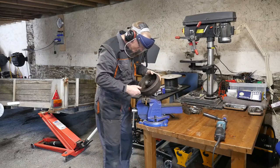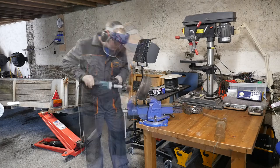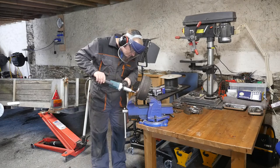Part three of the Bateson trailer repair. Let's start by fitting new brake shoes to the left hand side. I'm going to use a flat wheel in my die grinder to remove that outer inner edge, which will make putting the drum on easier and removing it easier.